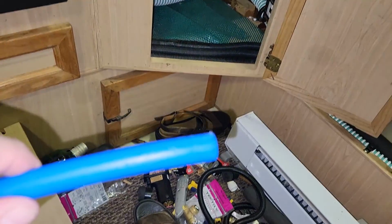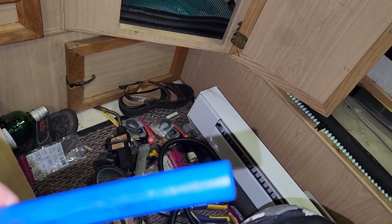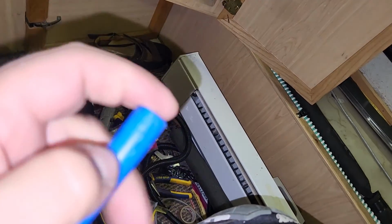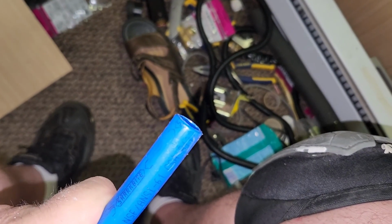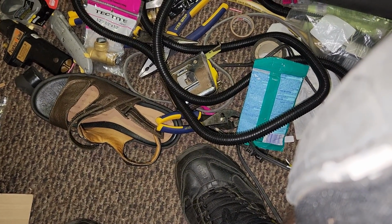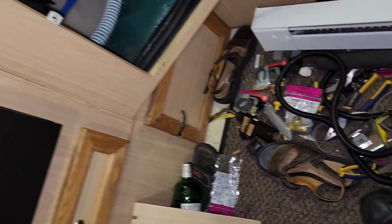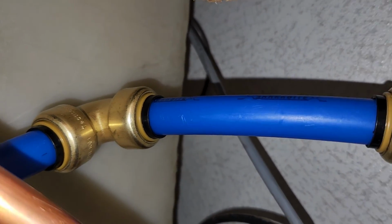Okay, so here is the problem with the leak on this. If you look at this pipe, right there, you can see that line in it. So you can just see that line going through the numbers there. You see that reflection of it there? And that line was just enough to let the O-ring not seal and have water just drip through. So I replaced that pipe with another the same, and now you can see we have no leakage, and that's what I like, is no leakage.